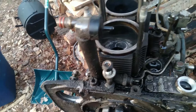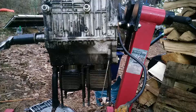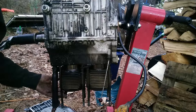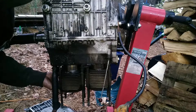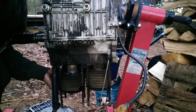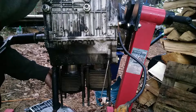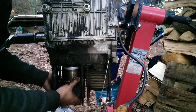That's the top of this engine pretty much done. Let's flip it over and get to the bottom end now. Some new information about how this thing is built: it's got removable cylinders, and the head bolts are also the main bolts. That's an interesting way to build an engine - leave it to the Germans.